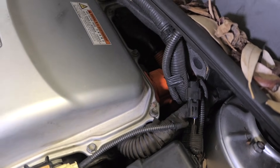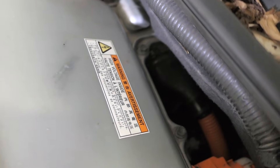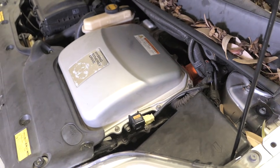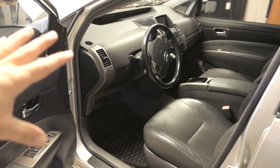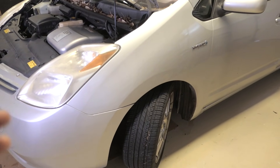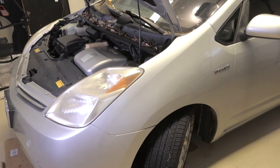If we open the door our actuator should come on — and sure enough it is, I can hear it making some noises, probably because it has air in it, but it does seem to work. I pumped the brake a little and the pump built up pressure and stopped — it seems to be working. I'm not turning the car on yet because I don't want the computer to flag errors until we can get all the air out of the system.